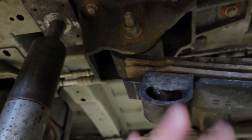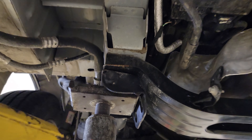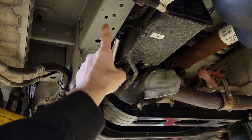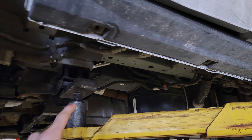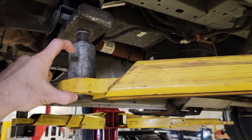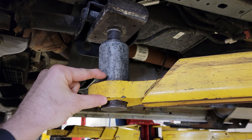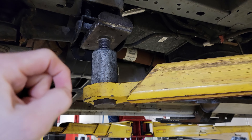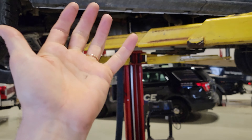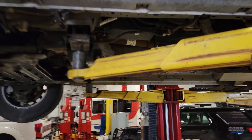Remember not to do your Transits by the pinch weld — you want to get on the unibody or the suspension components. Sometimes you can't lift the vehicle by that because you have to take it out to do repairs. Some of the Mustangs — the Shelbys rather — I have to do over here because these arms get down way smaller than my other ones across the way. When I'm prepping the Shelbys, the GT500s, and even when I have GTs over here, I have to use these hoists because of the low profile of the arms.